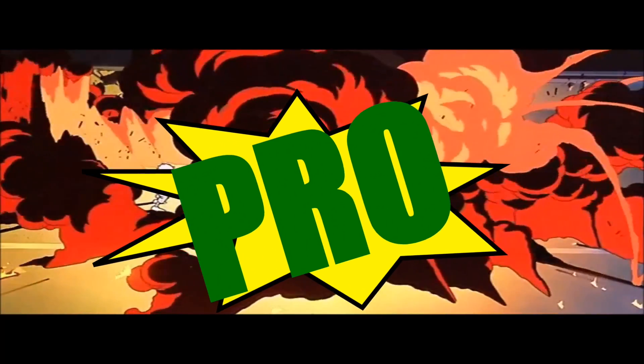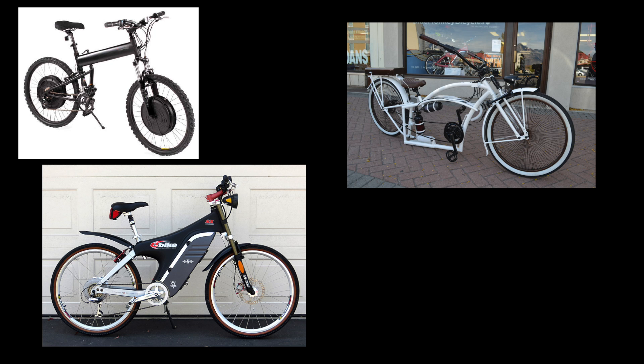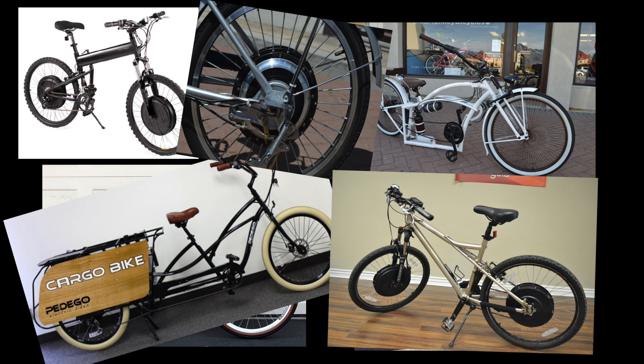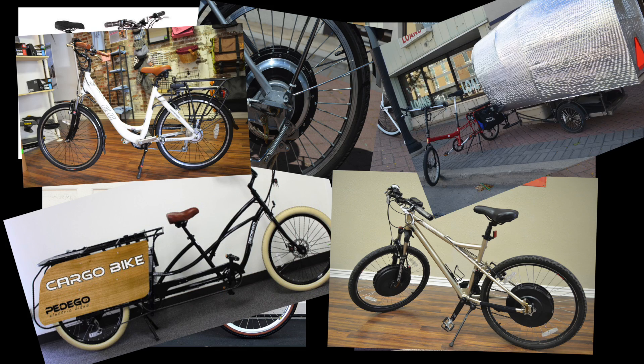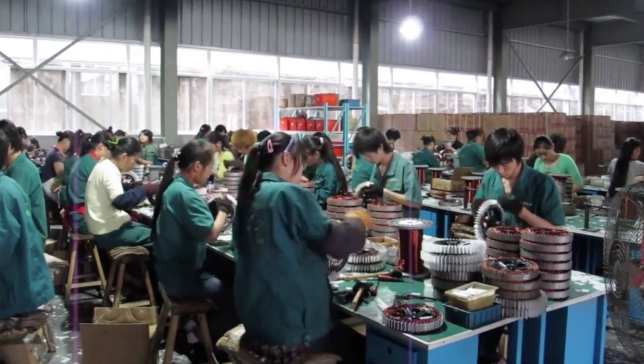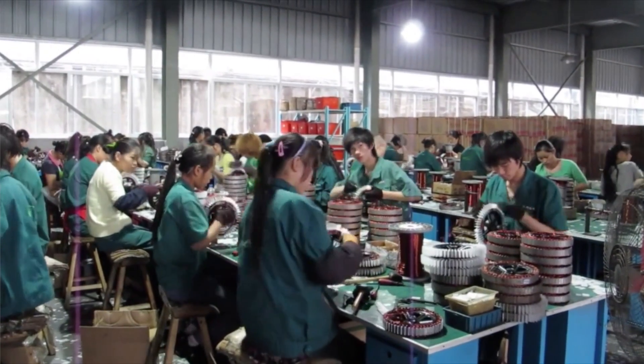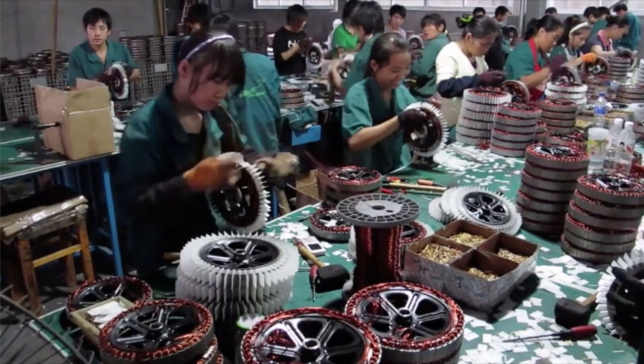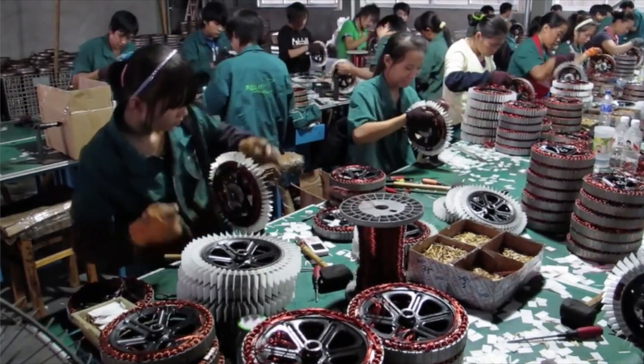Let's focus on just one for now, which is the hub drive, and we're going to start with the pros. First up, hub drives are cheap. From a manufacturing standpoint, they can be attached to a variety of different frames with just a few minor tweaks, so the designer has a lot of room to work with the rest of the bike. Hub drives have been manufactured on a large scale for quite some years, so there's a lot of options for low to high power, wheel size, all sorts of stuff. If you want to build your own electric bike, then a hub drive is an excellent way to start.